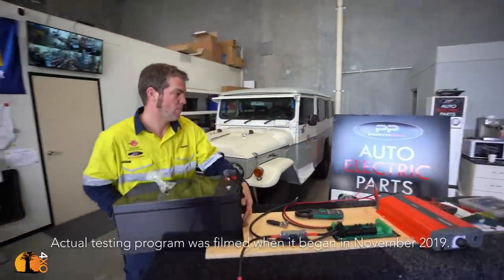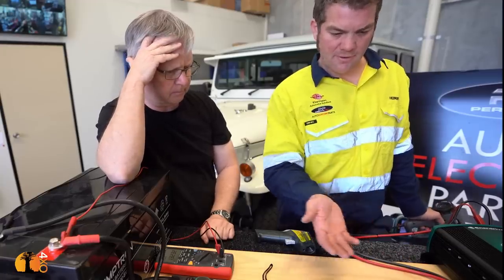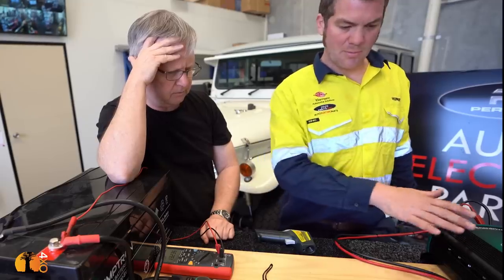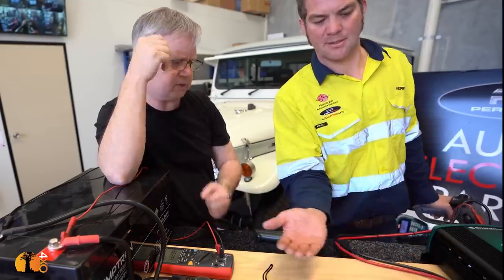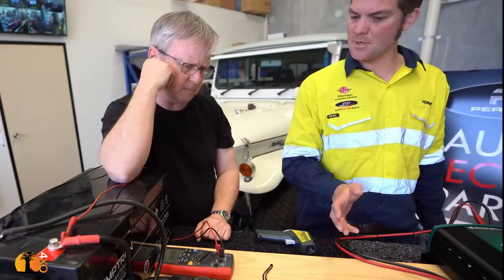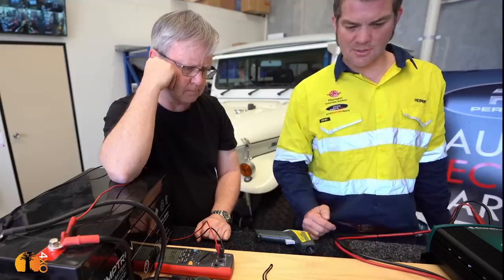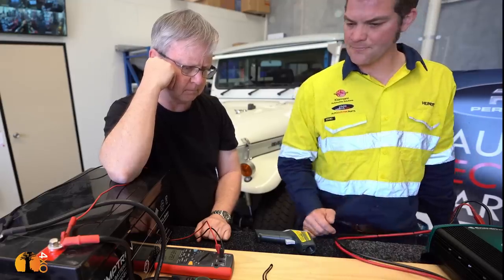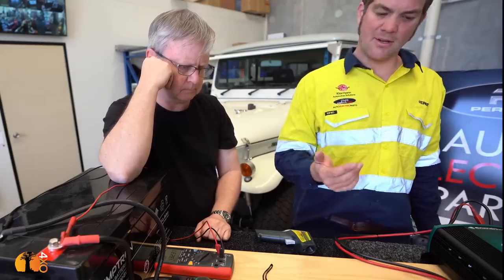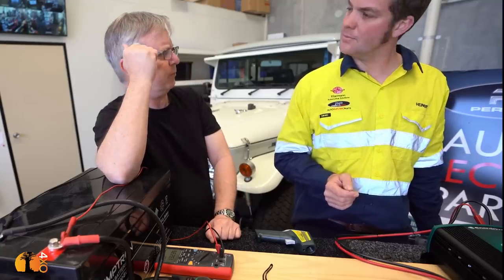We have a maximum of 60 amps, and we're going to crank it up to test it to its specification. We're going to leave it on 60 amps for a while to see if anything heats up — we're drawing current, not charging; we just want current flow. We want to see what the temperatures are doing on the circuit board, on the fuse holders, on the connectors. Once we establish temperature equilibrium, we'll later crank it up to see at what point the fuse blows and whether anything else gets hot before it blows.